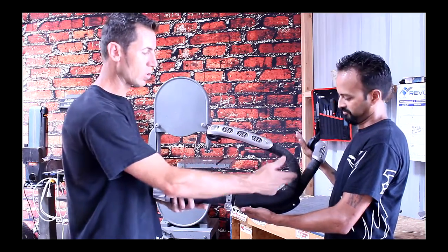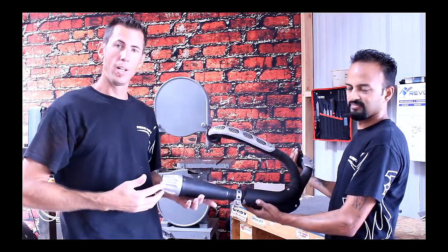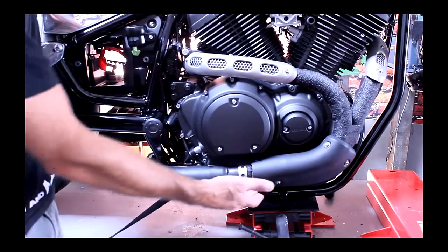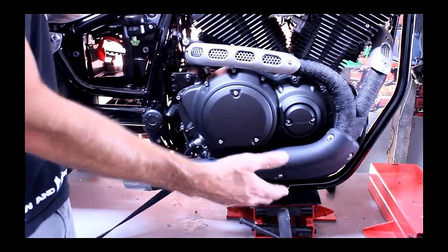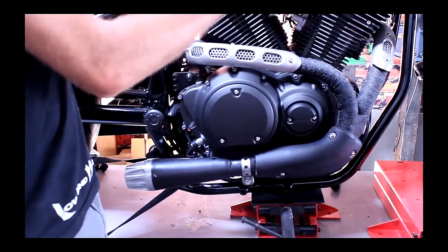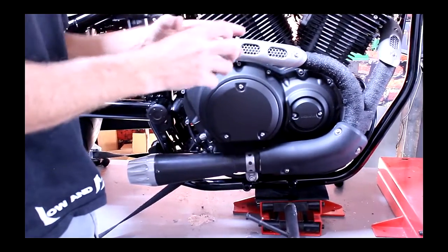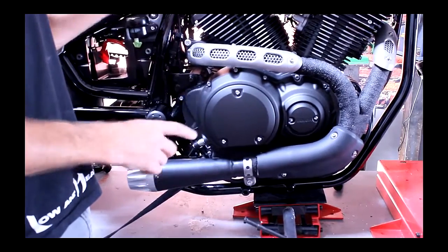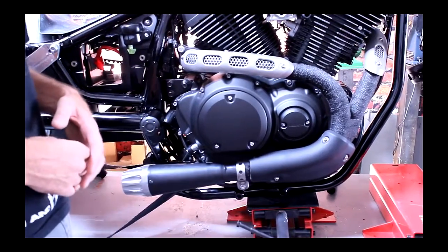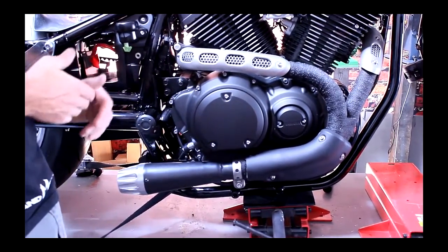We're gonna install the heat shields. There it is — another cost-effective way you can improve the performance and looks of your Star Bolt. We got the exhaust wrap on, a little honeycomb screen behind the stock heat shield, our megaphone muffler, and a new performance tip on the end. You'll notice it's dripping water from the wrap being in that tub — not to worry. When you start the motorcycle it's gonna steam a little, but after your first ride or two the exhaust wrap will shrink around the headers, tighten up, become very firm and permanent. You'll just enjoy the added performance and aesthetics.